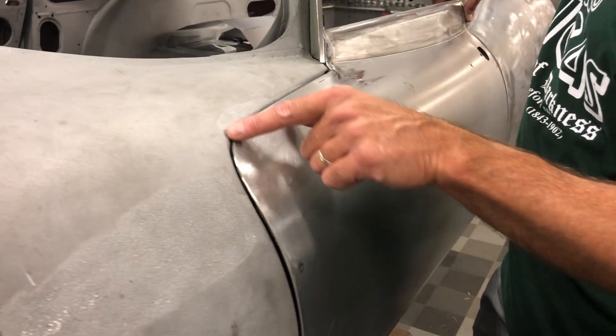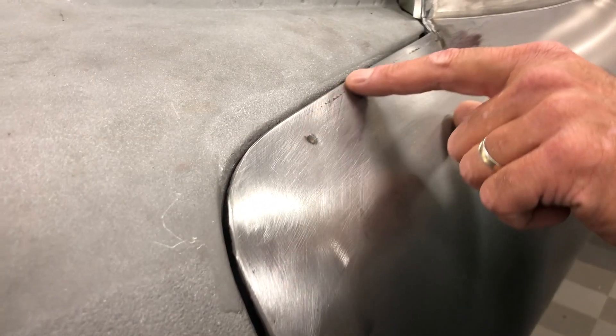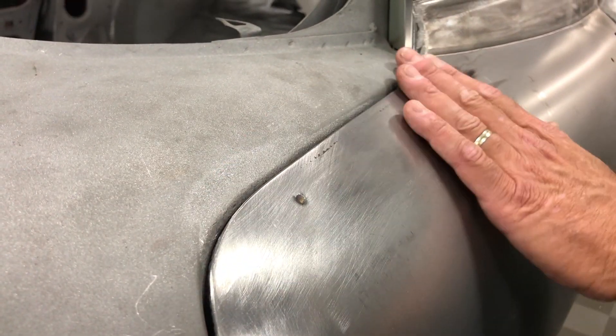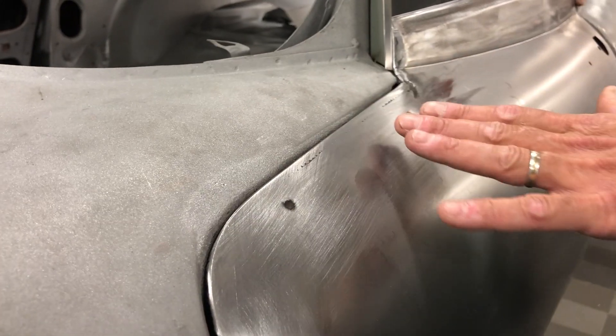This is real tight clearance, but you do want a tight fit up here. You can see where the factory has leaded this seam — we have actually built up this seam with lead. You can see the marks right there, dressed it down so that it is a little tighter up here on that horizontal seam.